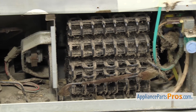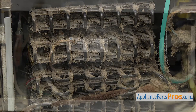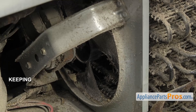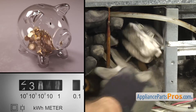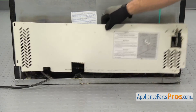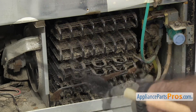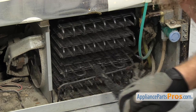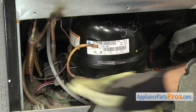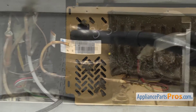Now here's that money-saving tip we mentioned earlier. If your freezer compartment isn't getting as cold as it used to and your ice cream is getting soft, it could be that your condenser coils are dirty. Dirty coils can cause the freezer to run warmer than normal if the condenser and other components are covered in dust and pet hair, insulating the coils and preventing them from working efficiently. This can also make the refrigerator run more and cause wear and tear. Keeping the coils clean can improve your refrigerator's efficiency by 30%, saving you money on your electric bill and future repair costs. Pull the refrigerator out, remove the rear access panel, and carefully clean the coils — some may be accessed from the front. Also clean the compressor, condenser motor and fan blade, and wipe down everything else. Do this at least once a year.